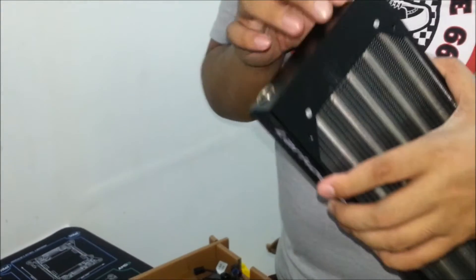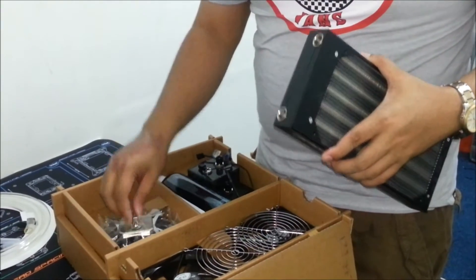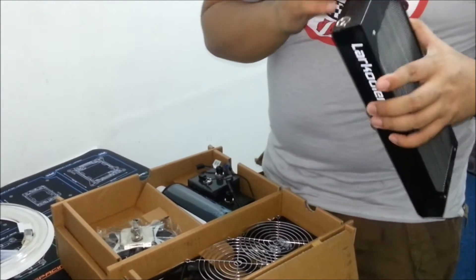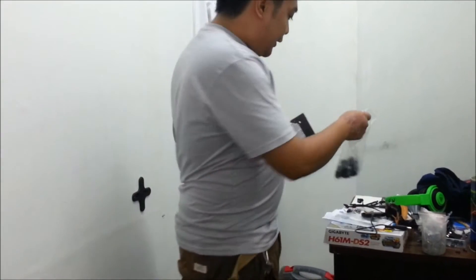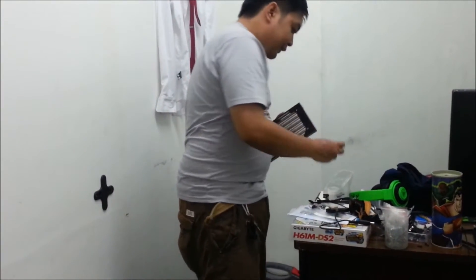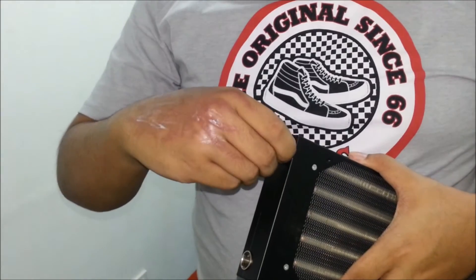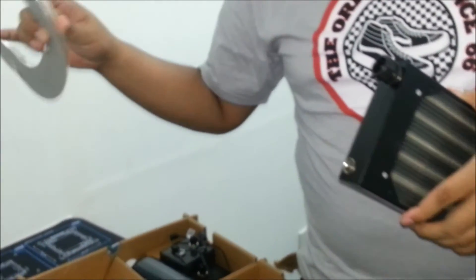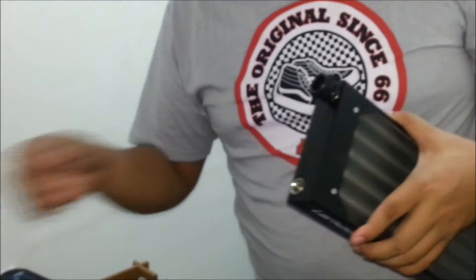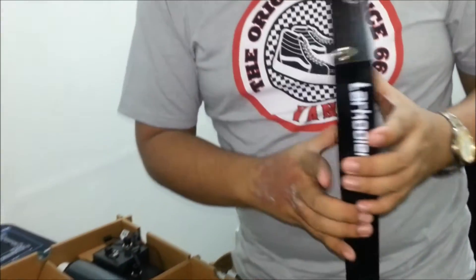What's good about this one is that Lark Cooler is adopting the G1/4 thread, so you could upgrade to any fittings that are G1/4. I have an example here — these are Bitspower fittings. So you could fit them here. It's a standard now, so you could upgrade from this 3/8 to 1/2 inch tube to a 3/8 to 5/8 inch tubing.